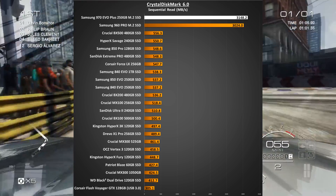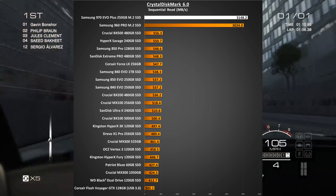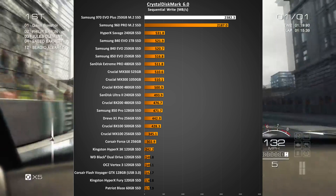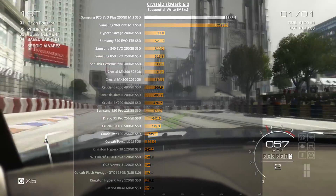In Crystal Disk Mark 6, the EVO Plus is miles ahead of regular 2.5-inch SSDs, and in write speed it's around 200 megabytes per second quicker than the Samsung 960 Pro M.2 as well. In Atto, read speed reaches 3,207 megabytes per second and write speed is 2,391, mirroring the performance seen in AS SSD. All in all, the Samsung 970 EVO Plus 250GB is a very good drive. Write speeds are a little lower than expected from an NVMe SSD, but this is due to the 250GB capacity.